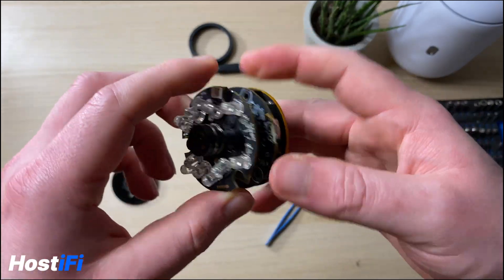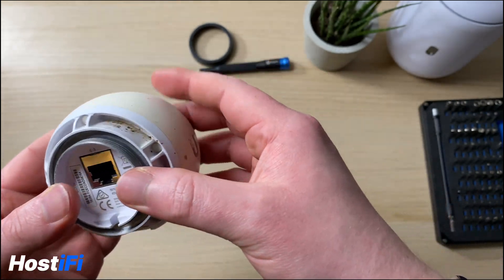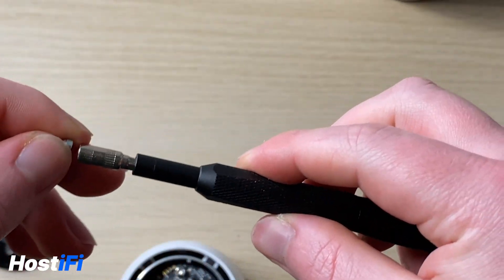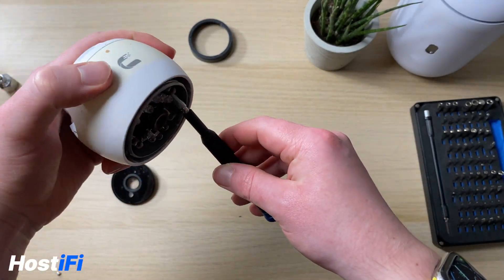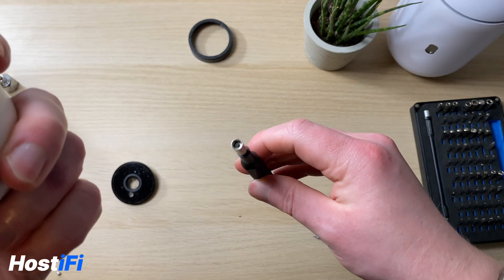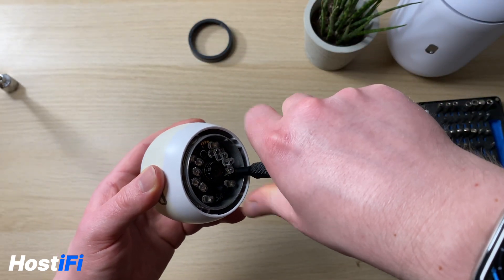Once that's done you can start reassembling the camera. I had a bit of a pain getting it back together. The top PCB with the infrared lights has two little pin sections, and that's really hard to line up with the bottom PCB once you've got the camera in. I found putting the washer on an iFixit screwdriver and turning the camera upside down so you don't drop the nut inside the camera was helpful — that took me quite a while to troubleshoot. I did actually lose the washer inside at one point. There are three nuts to do up again; just turn the camera upside down, put the screwdriver underneath, then turn it over again.